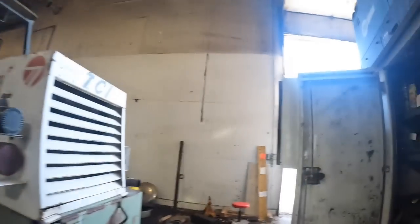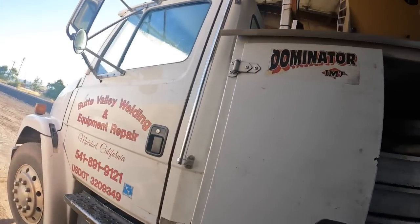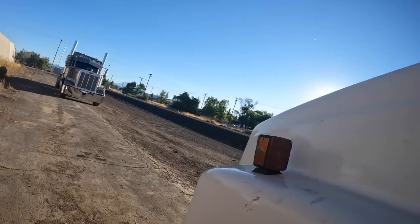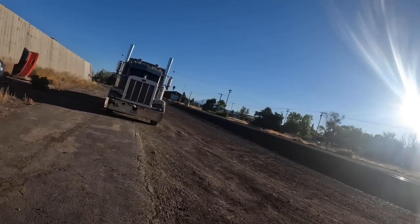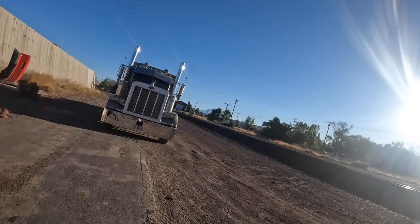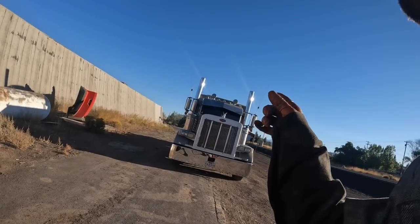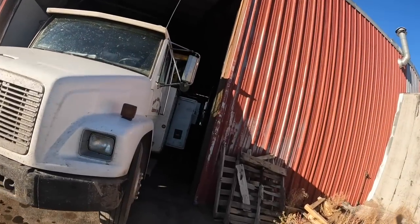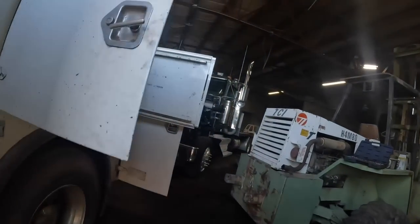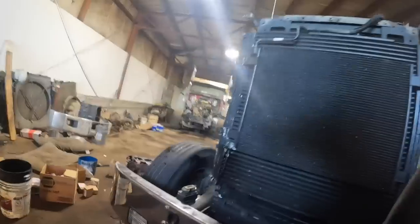I've got a 7330 that I'm gonna try to get to about daylight tomorrow morning. It's got turbo actuator faults and all kinds of stuff going on - that's obviously a CAN bus problem. Then I've got to tackle this front structure on this CM870. I did an in-frame on this one a long time ago but it needs metering actuators on the IFSM too because it smokes a lot at idle. But we're just going to get his leak fixed for now - he's hauling strawberry plants and that's a pretty good paying gig.